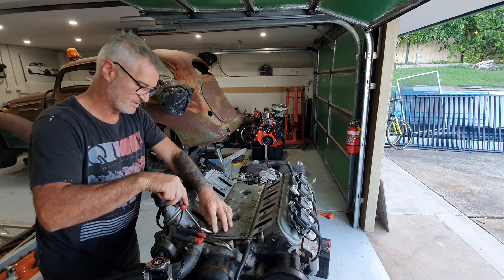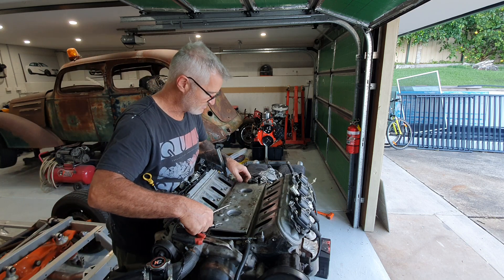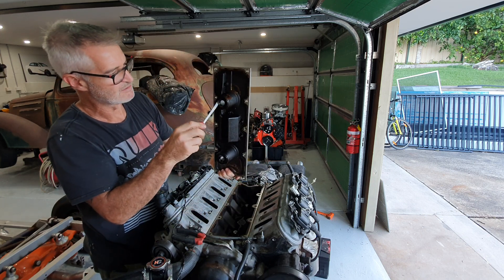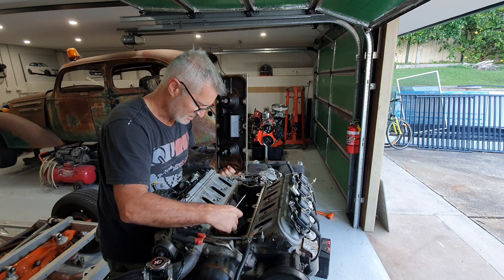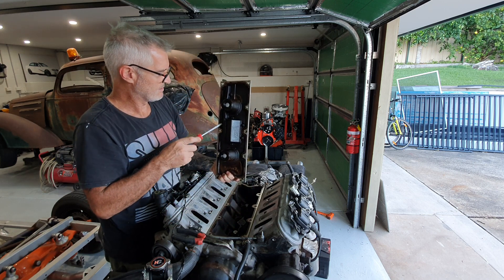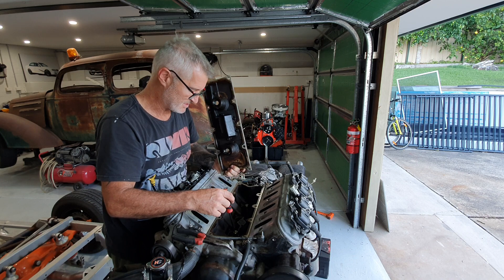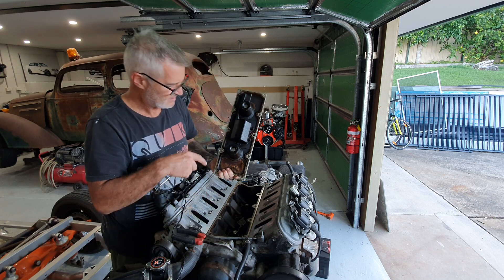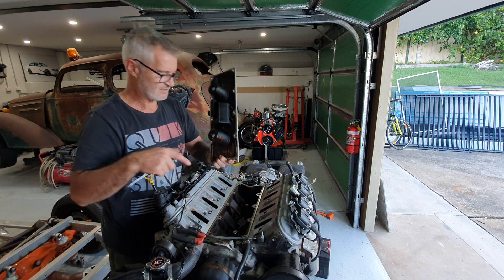Under the front here I just popped the cover up. It's got some rubber seals in the bottom where the knock sensors go — these rubber seals here are quite hard, so once they start leaking you get a bit of oil up in around this chamber. Not so much in Australia, but in American cars you get a lot of icy, salty water going down there because they salt their roads to break the ice — that makes it hard to get those knock sensors out. But this popped off really easily.